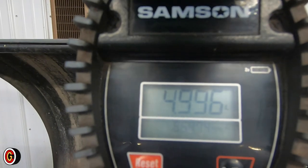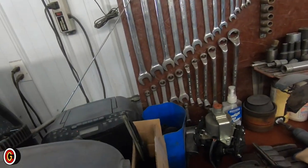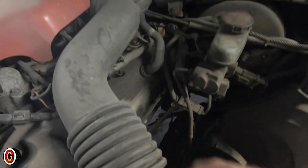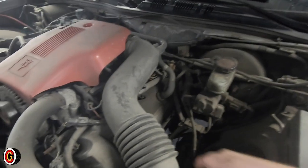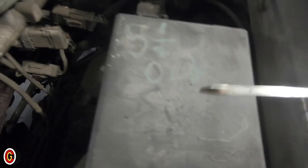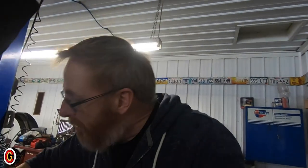I'm not quite sure what's going on — I just pumped five liters in. When we check the dipstick, it's barely showing to the add mark. The first thing you do when you pump five liters into your engine and it's not showing on the dipstick is look underneath and make sure you put the drain plug in. No oil dripping there.